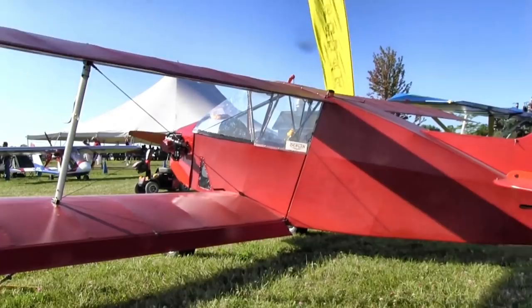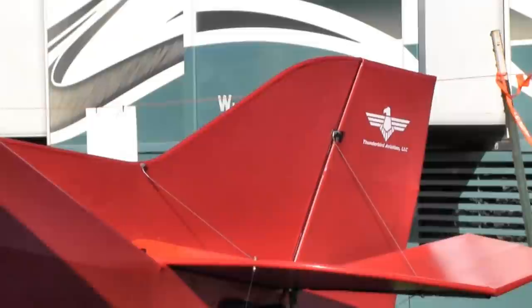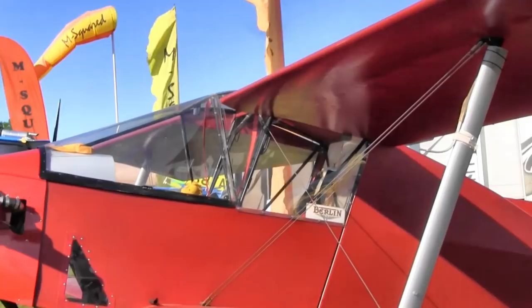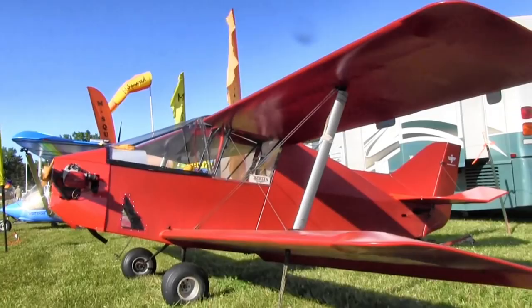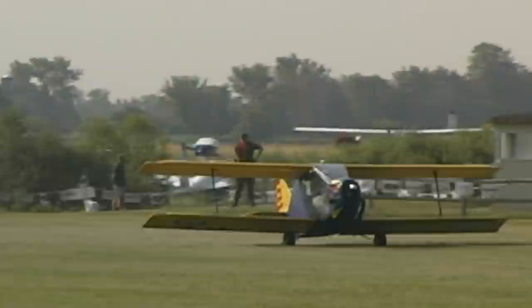If considering purchasing a used Hyperlight SNS-8, it is the Ultralight Flyer's recommendation that the plane's fabric be tested, the airframe, wings, landing gear, and the control systems be thoroughly inspected. If the history of the engine is unknown, it is recommended that the exhaust be removed and the pistons inspected for wear and seizure. At the time of production of this video, the Ultralight Flyer would estimate the value of a used Hyperlight SNS-8 from the 1980s to be worth between $4,500 and $6,500.